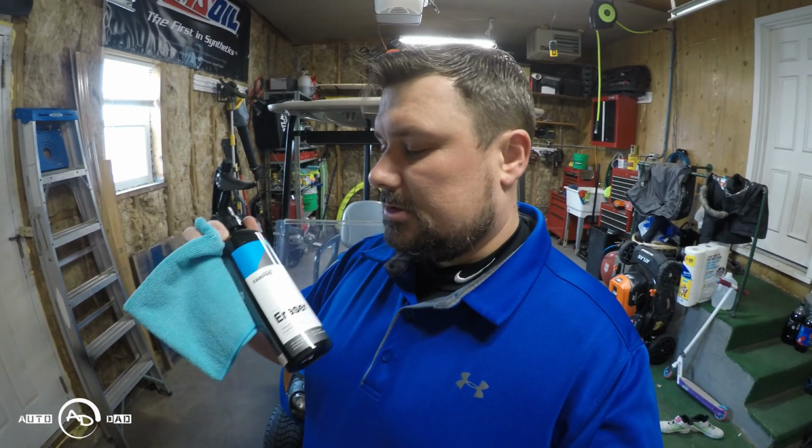Alright guys, so in this quick little video I am going to be ceramic coating the newly painted and cleared body on the Yamaha G29 golf cart. First step is I use CarPro Eraser. It is all isopropyl alcohol spray.